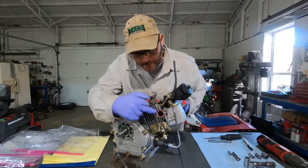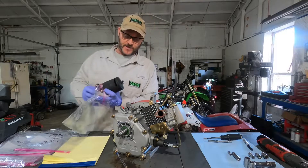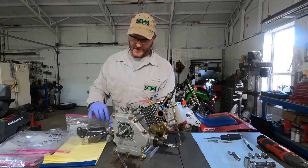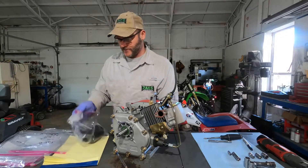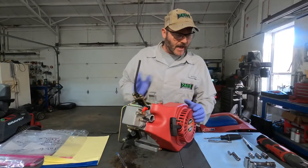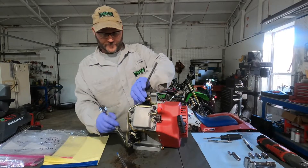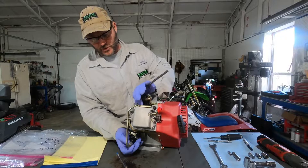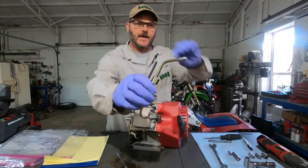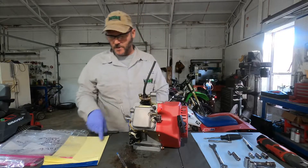As you can see the gasket stayed affixed — this machine has been run, or at least this one has. Not all Chinese engines that look similar come from the same factory — that is definitely not the case, some do, some don't. Now we're taking off the fuel injector line. It was one thing that was actually tightened up pretty well. It's 17 millimeter and it's bent to an angle that I don't think you could put it on upside down, but just in case — you'll see an anodized fitting and on the bottom you'll see a silver fitting. The silver fitting goes to the bottom.